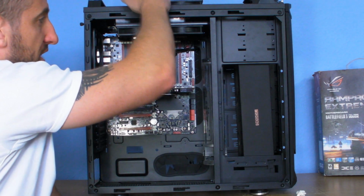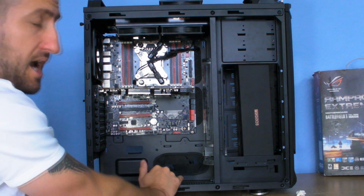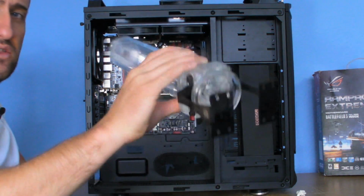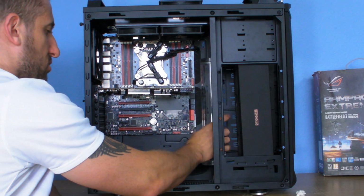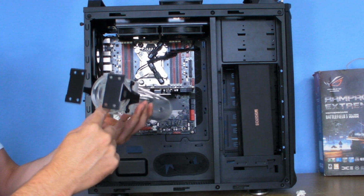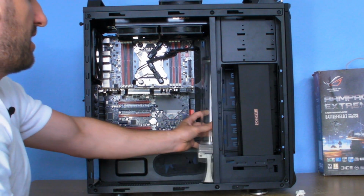I'll need to do the roof first, do all the cutting first, get everything tidied up before I start buggering about with the floor, because I don't want to mark the floor too much. What I also need to do is get the floor marked for the drilling points on these, so that when it does go in, it all kind of lines up. What I'm also going to need to do is put a hole in the floor, because the Vario's got an adjuster on the bottom, and I'd still like to be able to at least have access to it. So I'm going to have a hole in the floor.